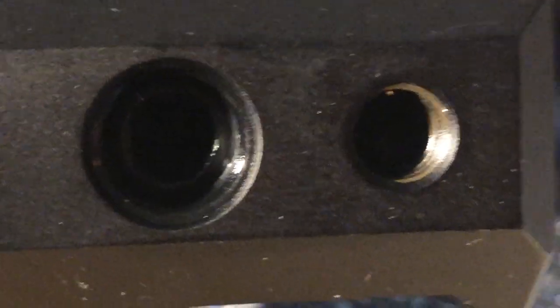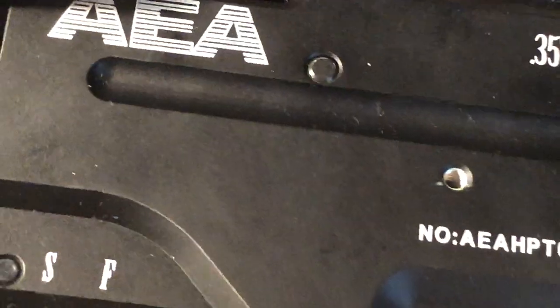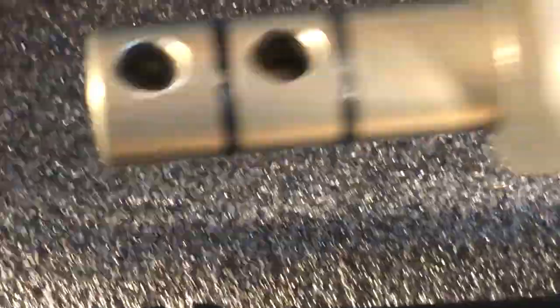The O-ring there, right? This O-ring here, you need to take it out and clean it, if you could. And then, when you plug in the tube, you want to make sure the tube is in the right direction. How to make sure it's in the right direction? It has to be plugged in. This is the place for that pin, for that fuel prop. When you plug all the way in, this side is up. Up, okay. Remember like this.